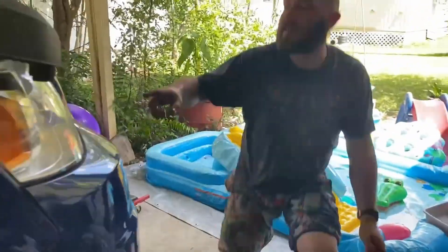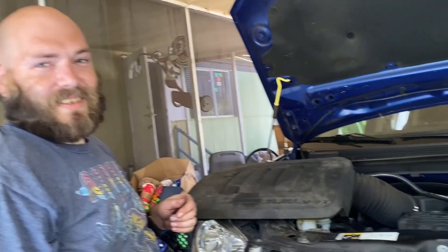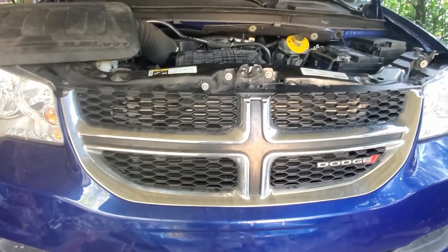So I reinstalled the battery box and put the battery back in. After the four torque converter bolts are in, I can put fluid in — ATF Plus Four — and give it a test run. I replaced the transmission; I have so much faith in this. The only thing not on right now is the brakes and the wheels. I'm gonna add some fluid and then give it a test run and we'll see how it goes.